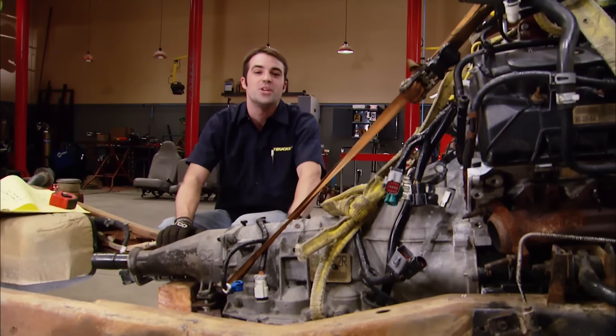The plan is just to create a flat mounting surface for the engine mount to sit on. I went ahead and cut out a cardboard template roughly the same size as the factory engine mount and cut a hole for the mounting stud. Once I transfer this over to 3/16ths plate, cut it out, and drill a hole, we'll install it, tighten down the nut, and tack weld the steel plate to the cross member. Then we'll pull the engine back out, burn in the welds, and add a gusset or two. We should be in good shape.